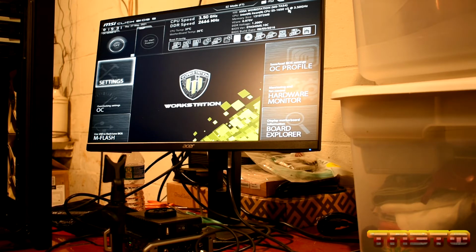You really need to have a really, really high clock speed for that. You need something like a 10900K or a new Ryzen, like a 3950X or whatever. You have to have a really excellent single core CPU to get the most out of a 3000 series GPU like this. I mean, it's being bottlenecked. It's probably going to perform around 2060 to 2070 Super performance. I think that's around the performance we'll get out of this with this existing CPU. If we get the upgrade Xeon, we might get a fair bit more, but you're not going to get the best out of this.